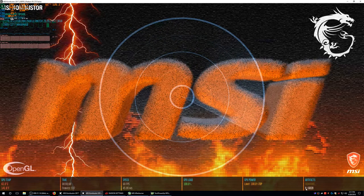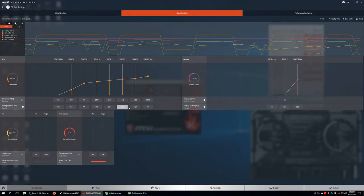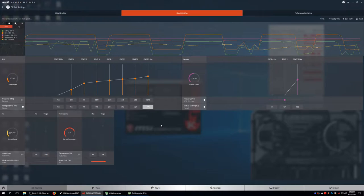It's reading artifacts but I'm not really seeing any big ones right now — oh, there's a big one. I just saw another. So that's a pretty good program. I'm not going to push it any further to make it crash. So I can't go any lower than 960 mV at 1340 MHz. Not so good, but at least I can save 20 watts. And 20 watts is 20 watts.